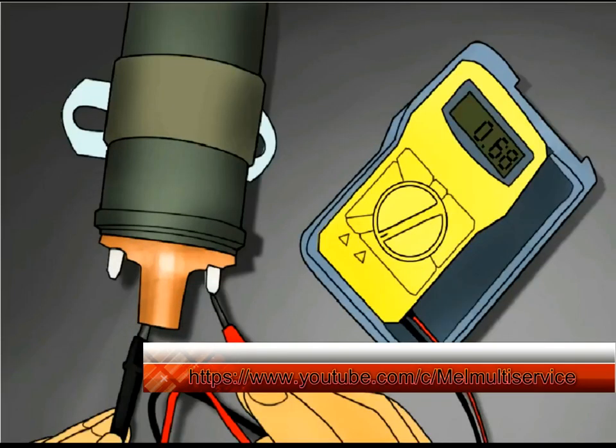Step 5: Test the secondary circuit of the ignition coil. Connect your multimeter to the positive terminal or pin of your coil and to the high output terminal that goes to the spark plug. Most ignition coils should have a secondary resistance falling somewhere between 6,000 to 10,000 ohms. However, refer to manufacturer's specifications for the correct range. If a reading of 0 is displayed, that signifies that the coil has short circuited and needs to be replaced, while an excessive reading signifies that the coil is open and also needs to be replaced.